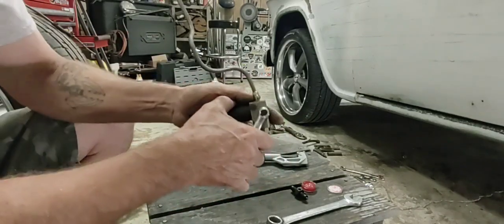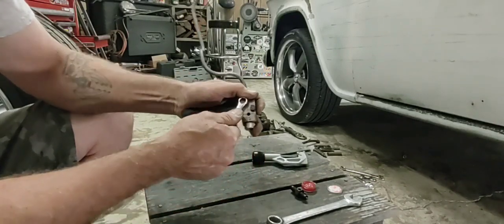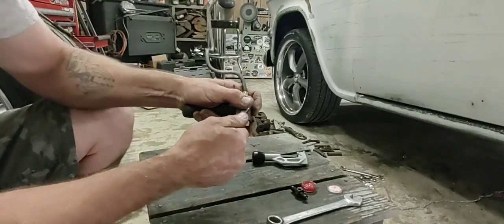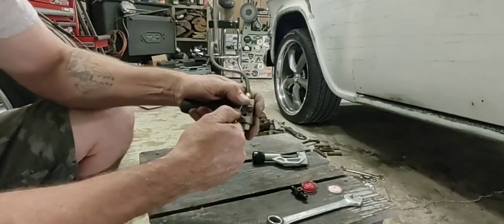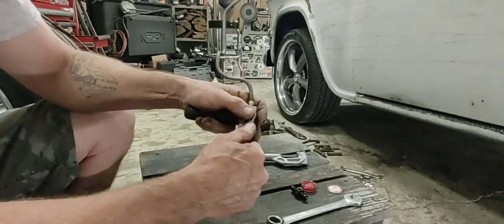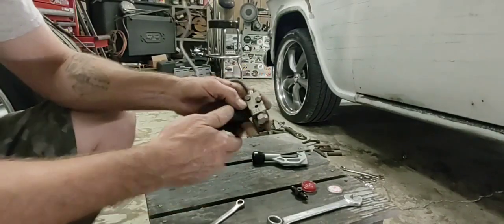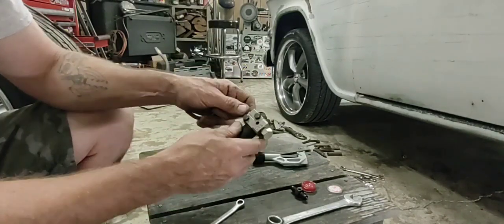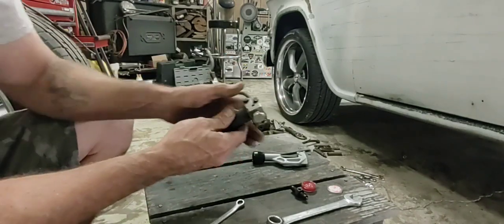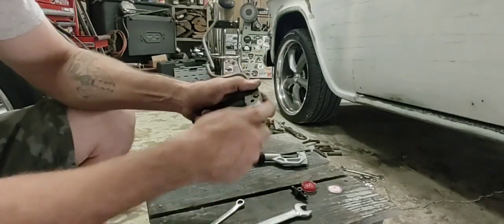The flaring tool was like 50 bucks. You can buy the expensive one that's like 500 bucks that does all different sizes of brake lines and fuel lines, but if you're just doing brake lines in quarter inch or three sixteenths you can buy either one. So that's tight now - in the little window it's dead tight against the jam nut. Then this little nut gets a little tight after you tighten those up, so crack it loose.